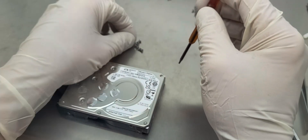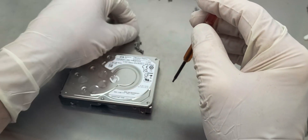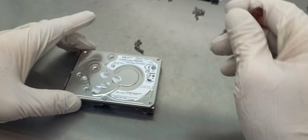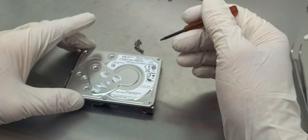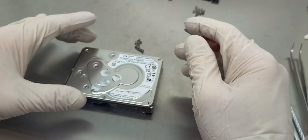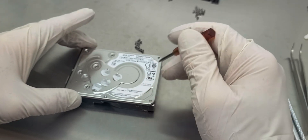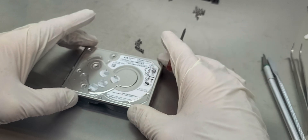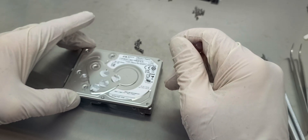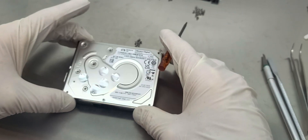Now this one has a lot of platters and a lot of heads. I think it has at least four platters, maybe five, and eight or ten heads. So it might be a problem between the mid platters or the bottom ones, so we're not going to see that. But usually we'll get an idea of what's going on by looking at the filter under the scope and just observing the overall condition of the heads, because the heads parked outside on this drive. We can zoom in and see if there are any issues — they should be off the platters right now, and if they have any damage or misalignment, we will be able to see that.